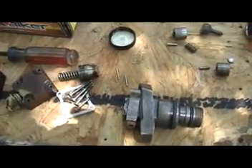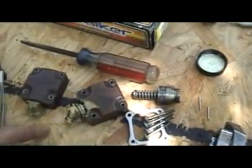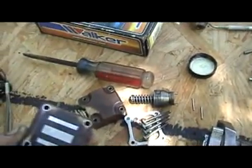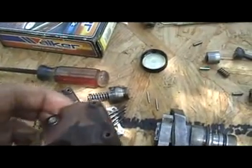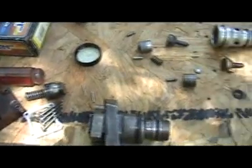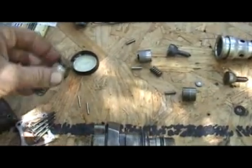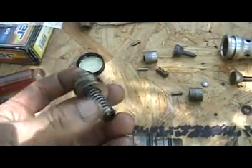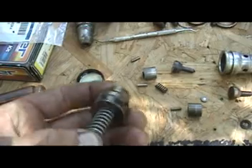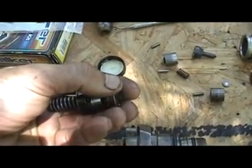Here's the 7.3. I've been cleaning everything up — cleaned up the top piece, a little spacer, and there's a broken solenoid on the top. I've got a new solenoid right here. This is what releases the little plunger that tells the signal to send down there. This is your main body right here. The little plunger is this little piece right here — it slides up and down and sends fuel in there. There's a little plate inside of this and I'm going to open it up and show you.